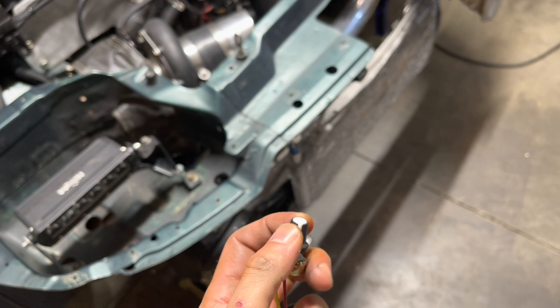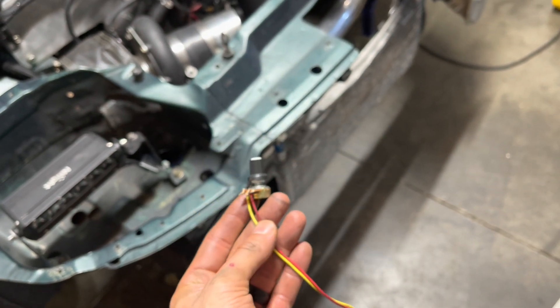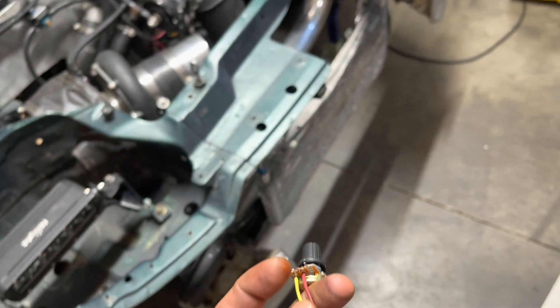Going straight to battery might work fine to get 14 volts, but just in case we'll give him a little voltage dial so he can adjust it. At this point I would say this method works well. I haven't even upgraded to a heavier potentiometer — using the same one — the wires don't get warm, the potentiometer doesn't get warm, and it's been some warm days, around 90-95 degrees outside. It's worth a shot — thought it'd be worth sharing for you guys to try on your cars.